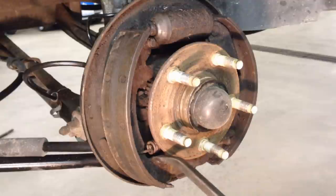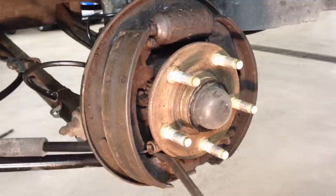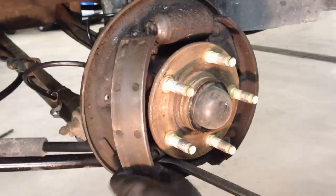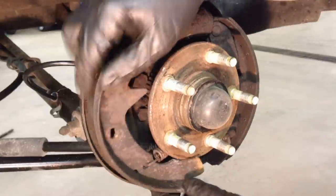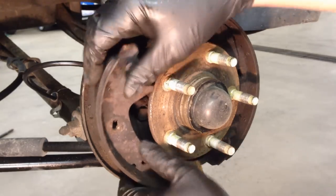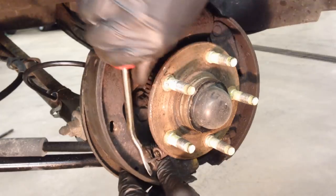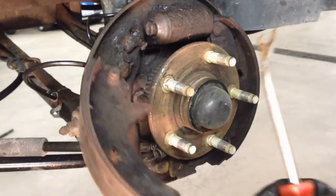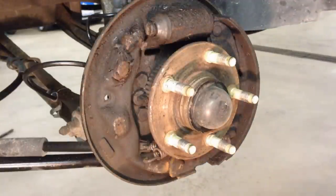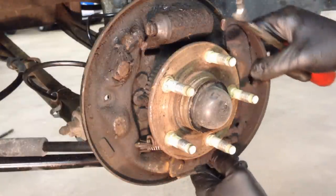It locks in right behind the tab. Once we get past it, we're free up here and the spring will release a lot of tension so we can unhook it and pull the other side off. The other side is the harder part because of the parking brake cable on it. Do this side first to get the spring tension released. Using the cat claw, work it off — it's got a slight hook to it. Keep these on the ground for reference. The spring comes out with the other side shoe.